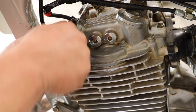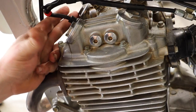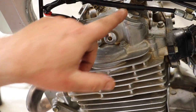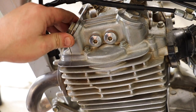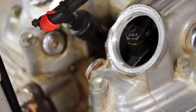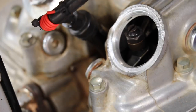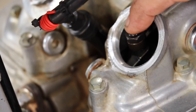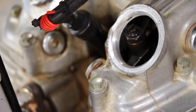Now that we've done that, we can take off our valve caps — there are four of them. This side is the exhaust side, and this is your intake side. Also, an easy way to check to see if you have top dead center is turning the crank — when it goes down, that's definitely not top dead center. Another way is to actually wiggle the valve; if it wiggles, you know you have top dead center.